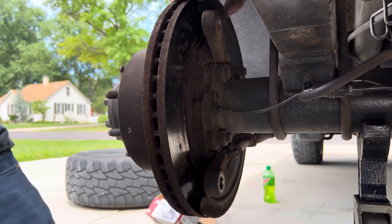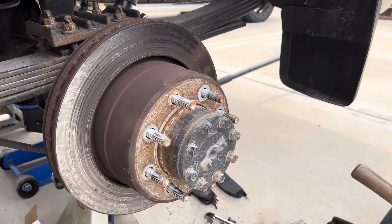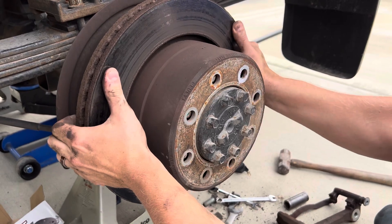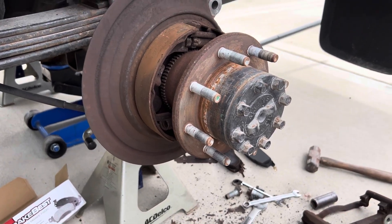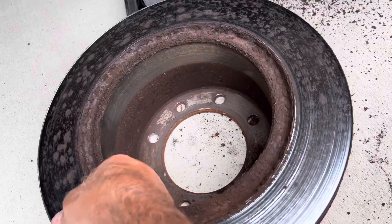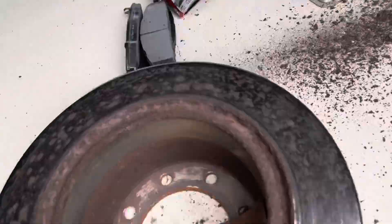That could be interesting getting this rotor off because we are changing the rotors. Oh damn, the emergency brake came apart — that's what was locking it up. Look how shiny it is where the emergency brake goes; it's been rubbing. Folks, I don't even use the emergency brake. I've never used it on this truck and I've had it a couple of years now. So you can see where it was actually rubbing.